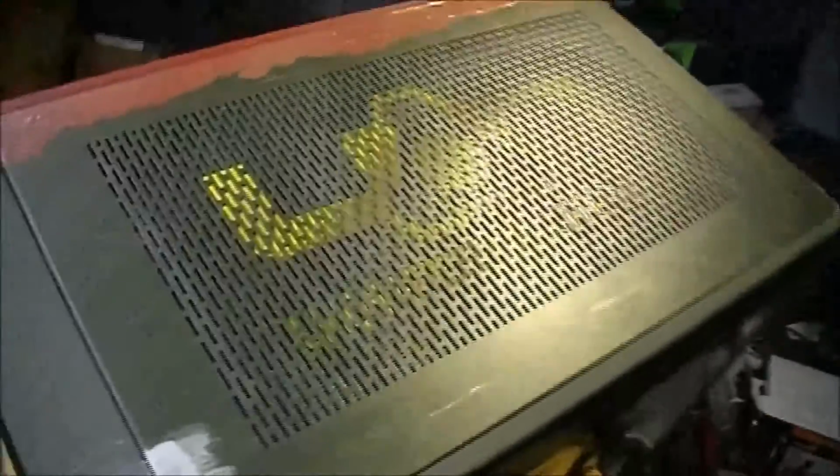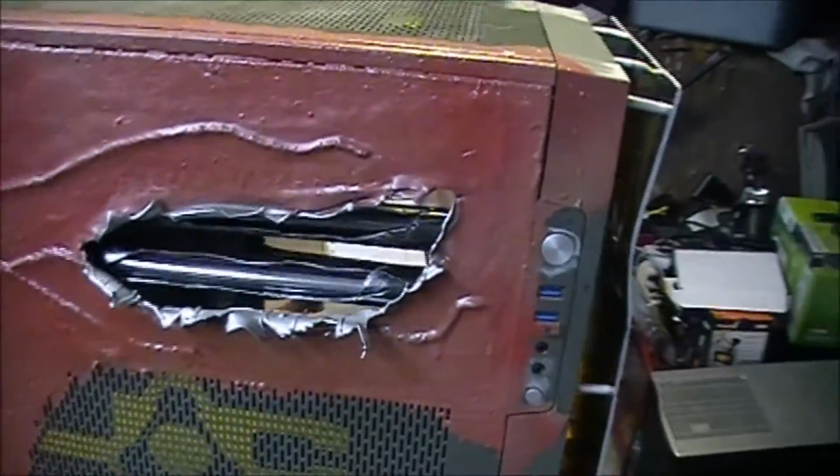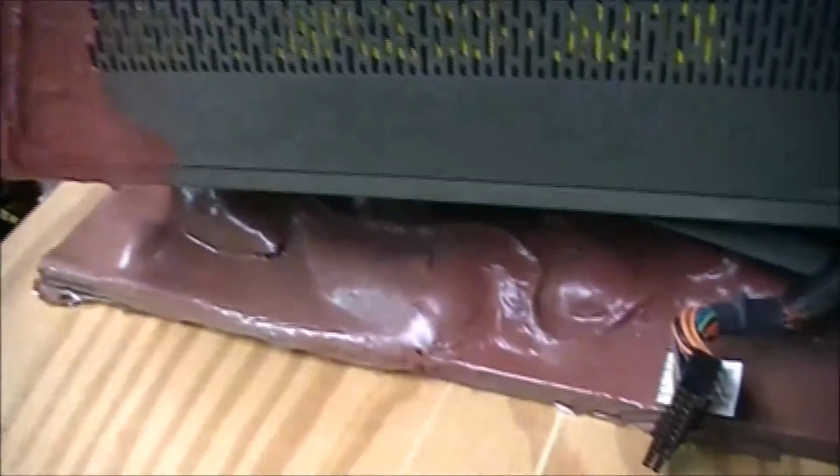There's another one of the magnetically attached UAC logos from the inside, because it's on the side. It's on one of the magnetic filters. That front panel is actually a piece of acrylic. I did acrylic, and then I painted graphite black on the back of it. And then I took a blowtorch to the front of it and a pair of needle nose pliers, and I pushed those bullet hole indentations that you saw into it.